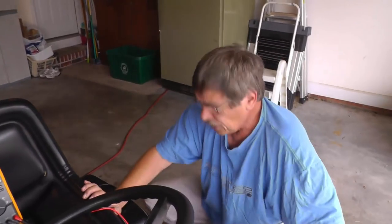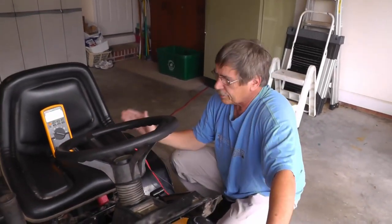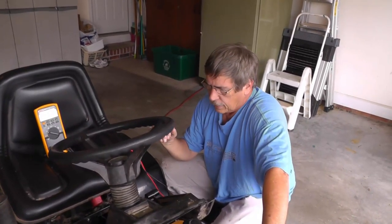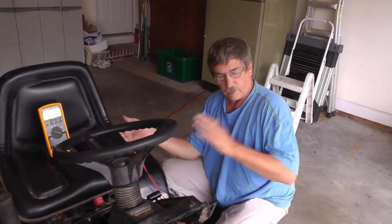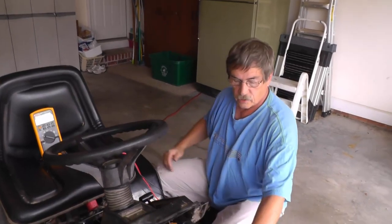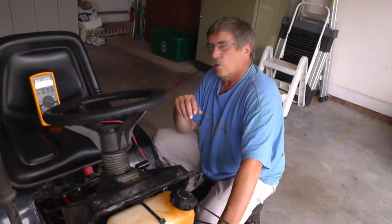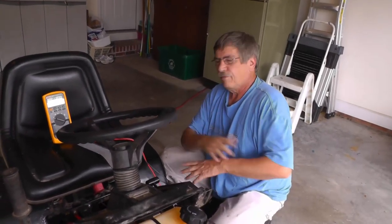Well, if I went all the way from the battery out to the DC ground where the starter is at, probably 0.1, 0.2 volts is the max. If we're on the positive side, from the positive side of the battery to where the positive terminal is connected to the starter, then maybe 0.3 to 0.6 volts. But what I do is just look at half a volt for the positive, half a volt for the negative. It's just a guideline.